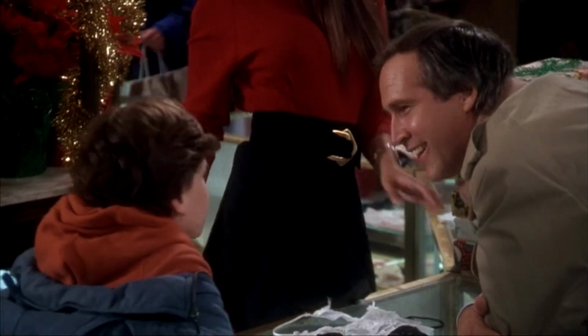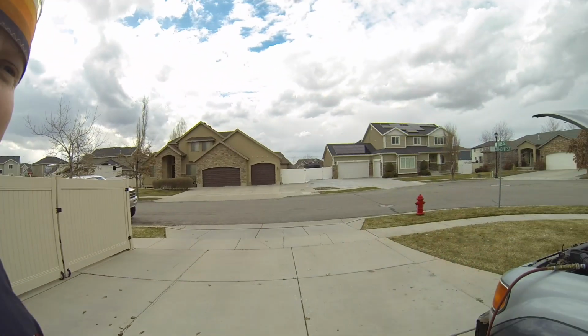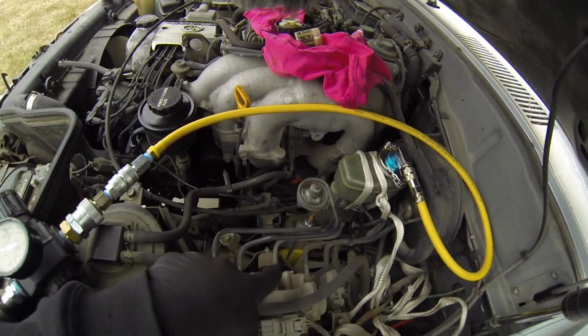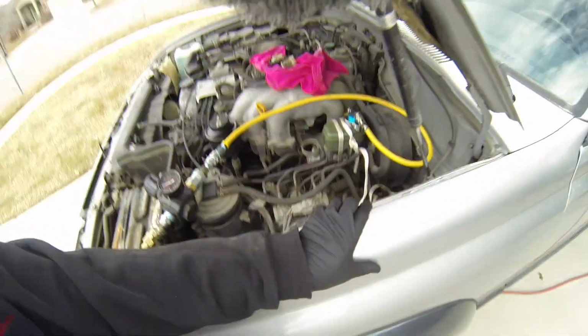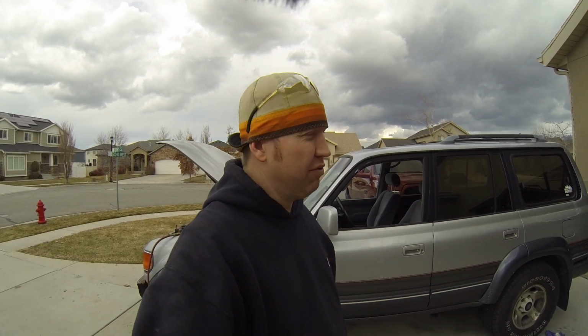We're gonna do the load valve last, but we'll start at the right rear, left rear. I mean, this thing, they say to follow the lines. Can't see the line, can you, Russ? No. But man, this thing's got brake lines everywhere. It's got one that goes up here, and through the module. They're all over the place. It's no wonder that these vehicles might be kind of tricky to bleed. So we're just gonna try it this way. We'll just push a ton of fluid through it, make sure that reservoir stays full, and then let's see what happens.